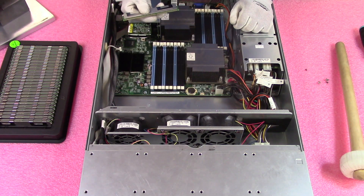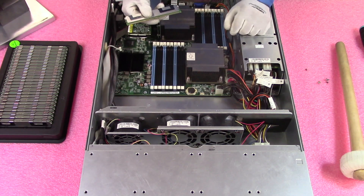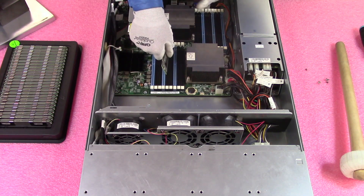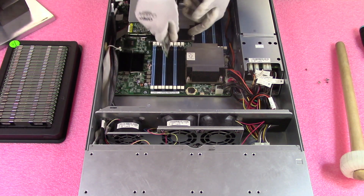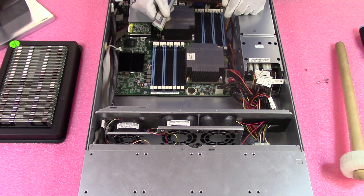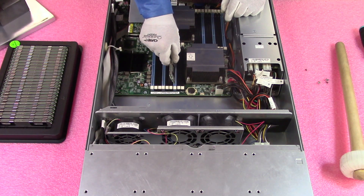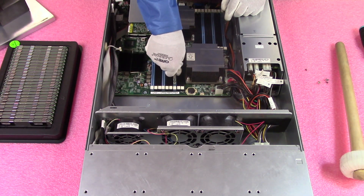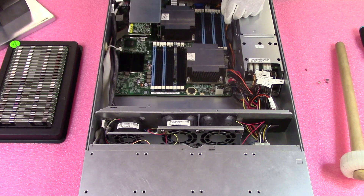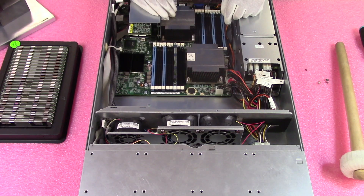So be very careful when installing to make sure you have it lined up properly. For instance, you get into a good groove installing on CPU 1 facing this way, and then it flips over at CPU 0 — and it's easy to have it the wrong way without realizing. Also, when you install the module and it feels like it's inserted, it may not actually be fully inserted. If you try to boot the machine, it would not register the module, and someone might think they have a bad DIMM — which is a very common user error. It's not a bad DIMM, it's just not properly seated.